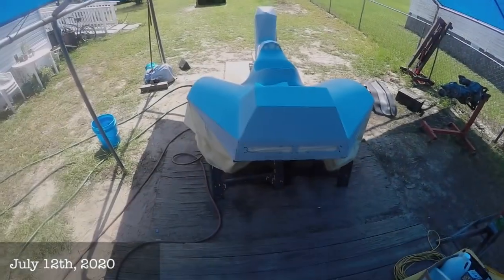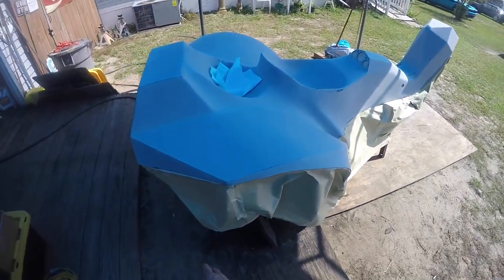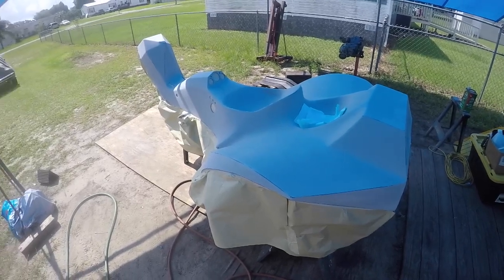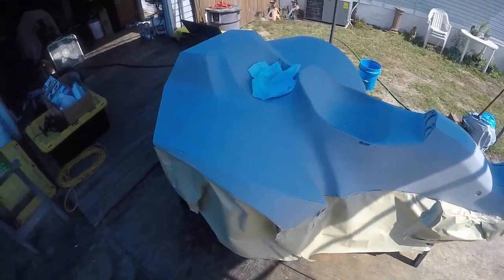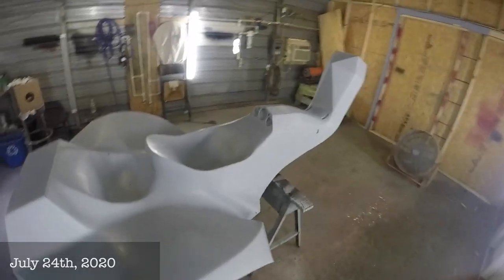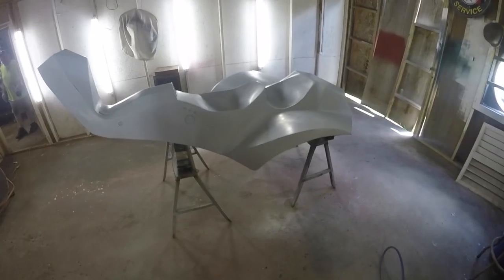Back on the trike going over the last glaze putty. I've sanded it down for its last high-build primer, which I'm going to reduce a little bit to lay it really nice so there's not a lot of sanding. After that I'll wet sand and shoot it. It's been on delay but we're back onto it - going to get it painted. I've got a little wiring left to do after it's painted, securing the pigtails that go into the main harness. Got it all masked here so I don't make a mess out of the undercarriage of the body.